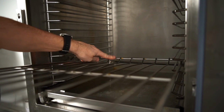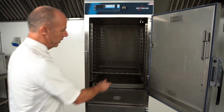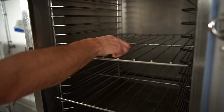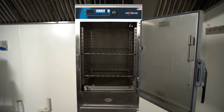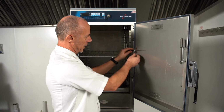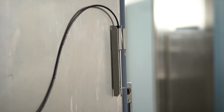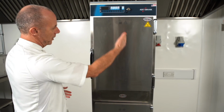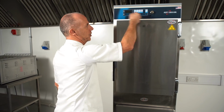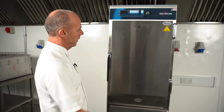Don't forget again the upstands at the back. That goes at the back of the unit. So when you pull out, you've always got leverage there. Just keep reloading. Put both trays in. So the 2 shelves, the probe can go back in. That's been cleaned nicely onto the points. Don't forget to thread it through the holders, and then it lives in that little house there. Close the door, and then spray around the front, spray on the PCB with your chemical. Don't jet water onto the fascia boards, just do soapy water with a cloth or your cleaner, and then sanitize.